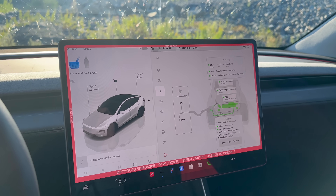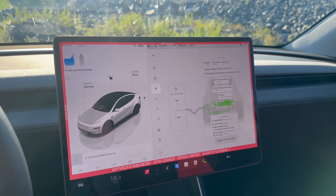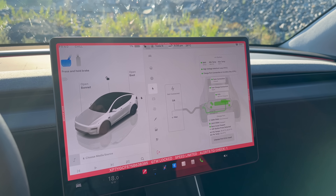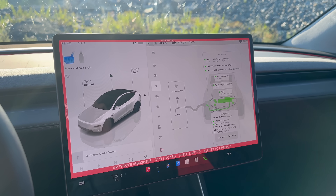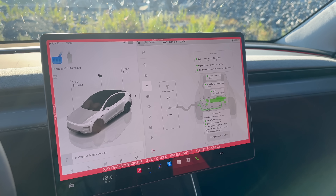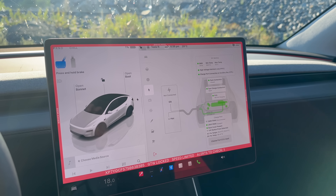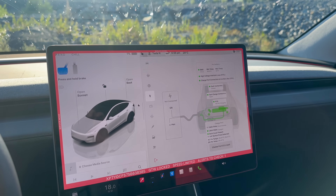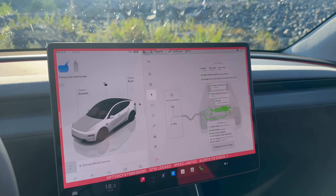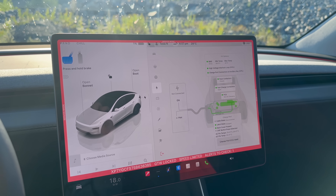After testing and looking at data online, it seems like the CATL pack from the old Model Y and Model 3 — the 60 kWh CATL pack — really likes to be warm. This has been an issue in winter in Norway, where these cars have cold-gated and charged well initially, then suddenly been unable to heat the pack enough to receive the required power. This is completely the opposite behavior of the BYD Blade Battery.